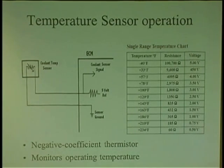And if they don't, they actually look at the coolant sensor. If it takes too long to change, do you realize it won't run a lot of OBD II monitors? Because it says it took too long. It won't even tell you that. I happened to look at some monitors on a Toyota, because when you go to OBD II monitors, it actually has an extra monitor for the thermostat. I'm like, thermostat? So they put that in there themselves. They're checking the thermostat to see whether or not it passes, because they're looking at how long it takes for the car to heat up. So you can have suspended monitors that'll never run because of a bad thermostat, and you have no code for it. So these guys have to work.